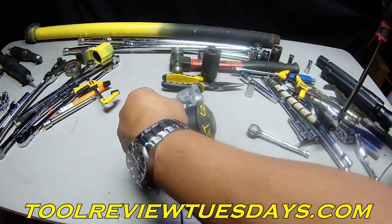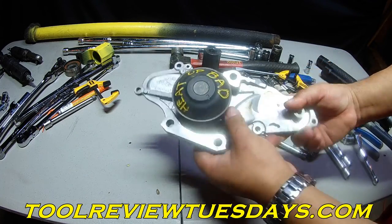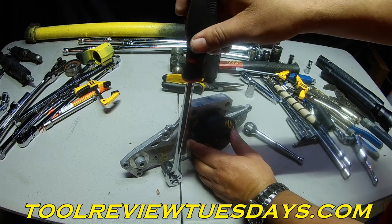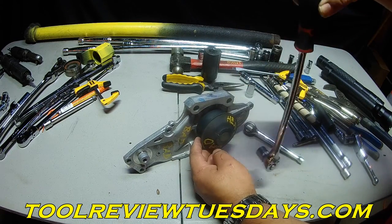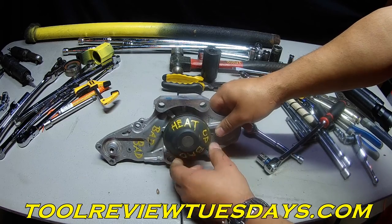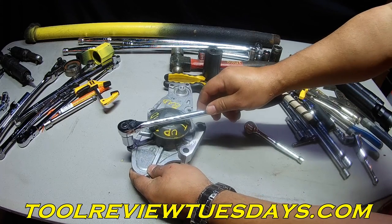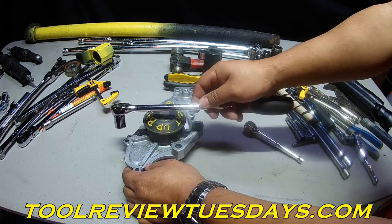So like on this timing belt for this Honda V6, there's five 10-millimeter bolts. It sits on the side of the engine, so you can just come down here and get the bolt loose, because typically you have other stuff here kind of in your way. Or to get around the crank for the water pump to these bolts down here — you just come in with a long quarter-inch, a deep quarter-inch, and you're able to loosen up those bolts.